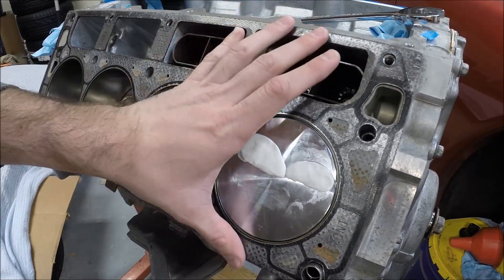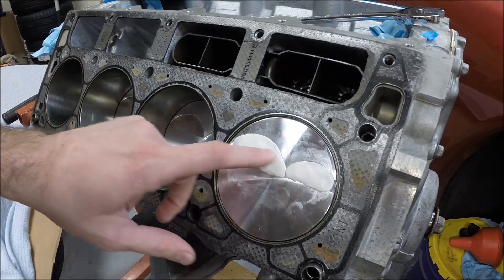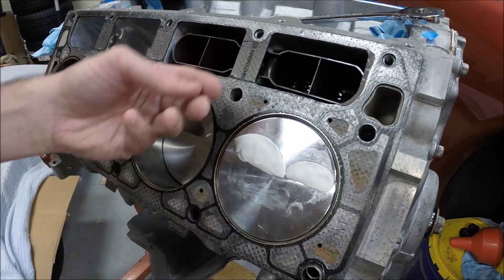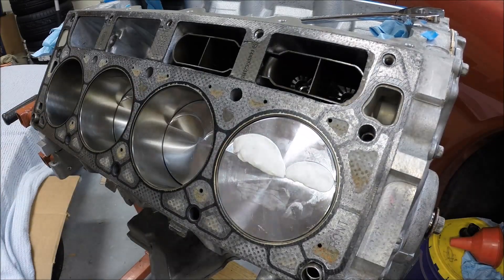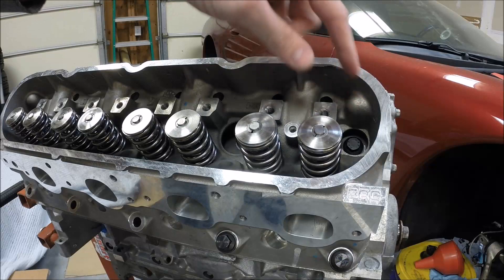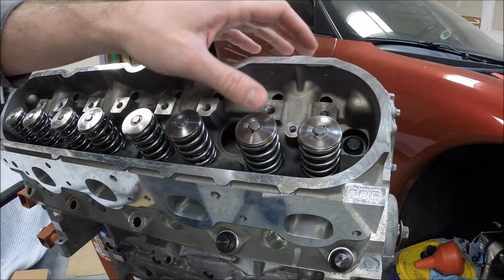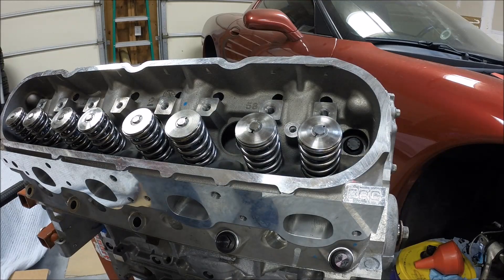So we'll finish assembling this. We'll put our cylinder head on with our push rods and then we'll rotate the motor over so that both the intake and the exhaust valves open. As they open they'll press down and make an impression in the modeling clay. Then we can slice this and see a profile section, and measure and confirm how much clearance we have. One tip: before you put the cylinder head on, spray some WD-40 on the intake and exhaust valves for the cylinder you're going to be working on. That'll help prevent any clay from sticking to the valve — you certainly wouldn't want to get that on your valve seats.